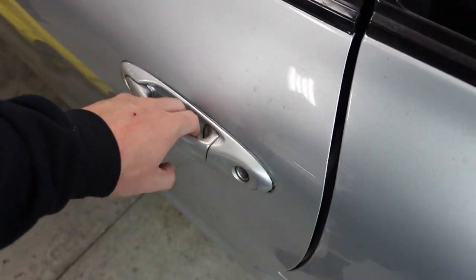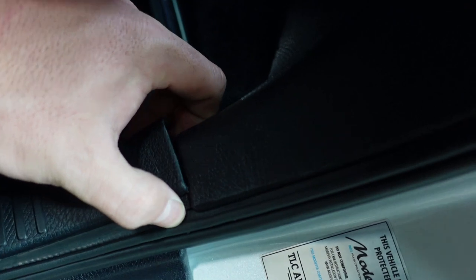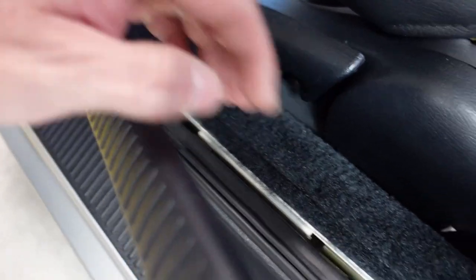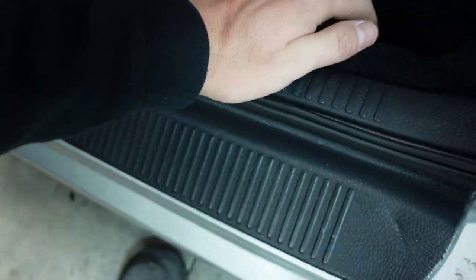Not a big problem, you'd be correct — kind of. The problem is right here it gets stuck. There is a tab — this tab's broken on this one, you can see the tab broke off years ago. The problem is on this side: see how there's these cables here? These cables here are for your hood, or for your trunk latch. When you're trying to put it in there it causes a bit of a bind up, and it also puts pressure on them, which I don't like.